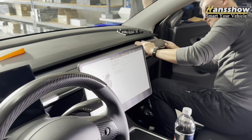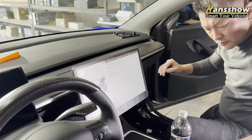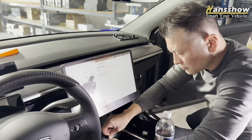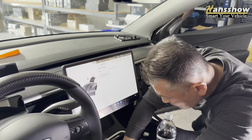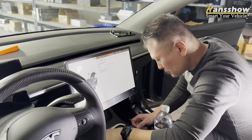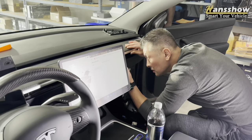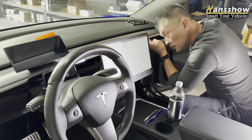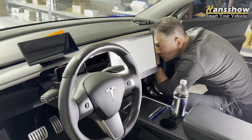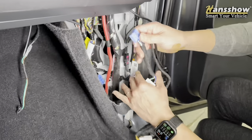Pinched wires could potentially cut your wires, making your display non-functional. That is your responsibility to ensure those wires are clear of any obstacle. You can use electrical tape to tape it down — that is highly suggested. Make sure those wires are not pinching.